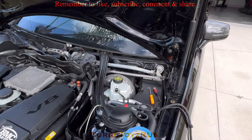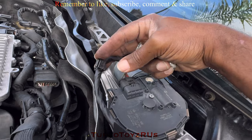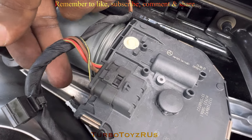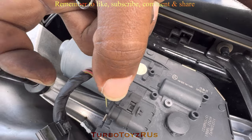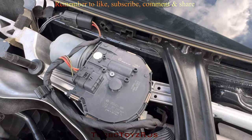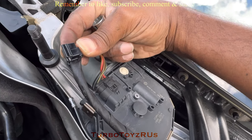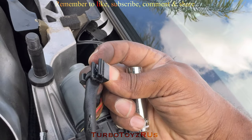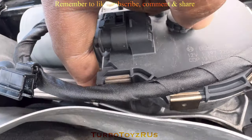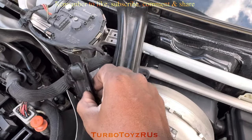There are two clips that I had to pull just down there. There's a metal piece that goes under there, so what I did was separate the plastic from over this metal piece you see here. It hooks on around it — kind of like so. I had to use my little hook here and a tiny flat screwdriver to get this piece over it. See, it kind of hooks in there — there are two of them, one there and one right there. This allows you to free up the harness a little bit more.